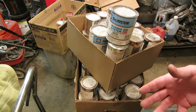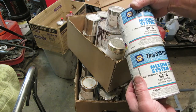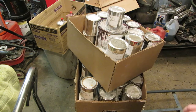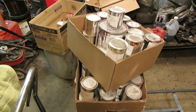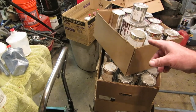What denotes this paint job is I had a body shop give me 3 quarts of small blue mica. Okay, and that translates into a light pearl blue. So right off the bat, I have 3 quarts of light pearl blue that has not been reduced. Sprayable reduction on 2 quarts would give 3 quarts of sprayable material. We need about 1.5 gallons of sprayable material, so I have another quart in there.